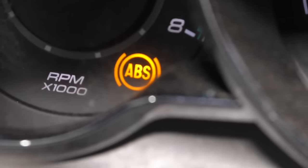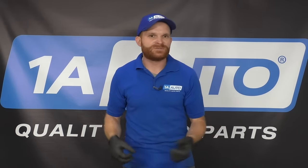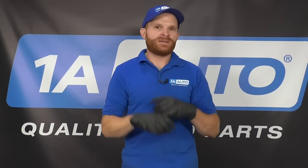Something I also want to mention is don't confuse a brake pulsation with your ABS unit activating - the anti-lock brake system. The ABS on your vehicle is supposed to create a controlled stop in case of an emergency instead of a sliding, skidding stop where you could slide past where you want to stop. When your ABS activates, it's going to cause a pulsation in the brake pedal and it might be confused with a brake pulsation, but it's actually just the computer of the vehicle doing its job.